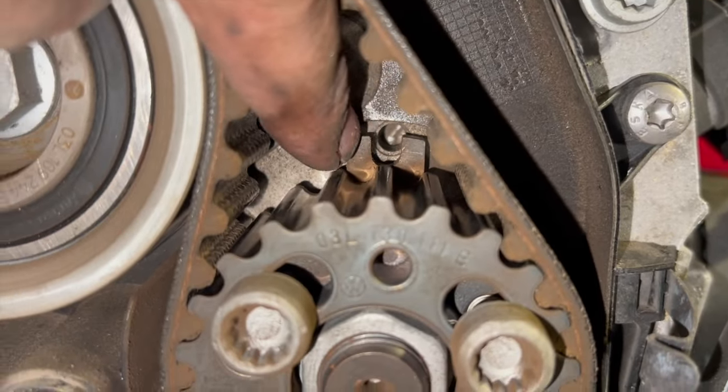So next thing I'm gonna do now is just give this a little bit of a clean up, just with a rag and a bit of emery cloth. Now these engines aren't too bad for it. The seal sits on the inside of the pump and just sits in that surface there, so don't get too manky. Some engines where they bolt up can get really sort of crusty around here, but we'll just give that a nice clean up just to make sure the new pump sits in nicely. And once we do that, we'll get the pump on, we'll torque it up, and then we can wash all this coolant off. Obviously antifreeze is a lubricant, so you don't really want it anywhere that the belt's going to get on. But once we've got the pump on and torqued up, then we can wash this off with some brake cleaner. We'll just get that cleaned up quickly and run you on to the next step after that.